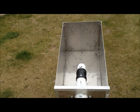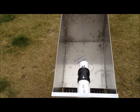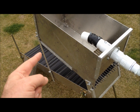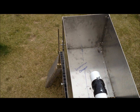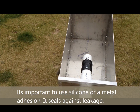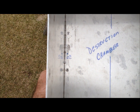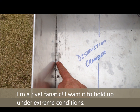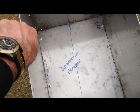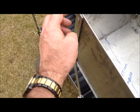After I cut the pieces to the sizes I wanted, I started with the bottom and worked the sides into it. I used a piece of angled aluminum on each side to hold it in place, put two strips of silicone adhesive on the underside of the aluminum that would come in contact with the angled aluminum, and then riveted it in. I used five thirty-seconds rivets, spacing them about every six inches on both sides. Then I put the walls in place, riveted, and sealed the inside. I had to use some clamps and do it all by myself, so it was kind of awkward at times.